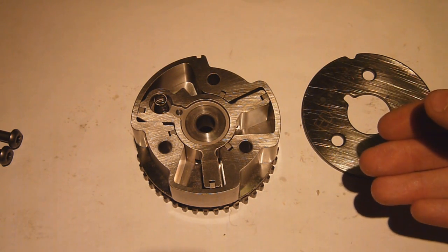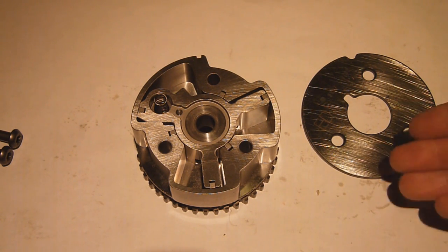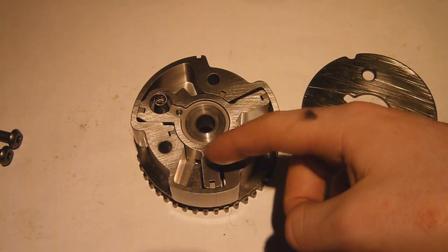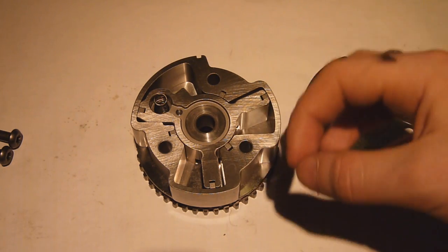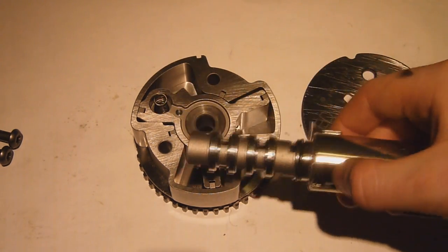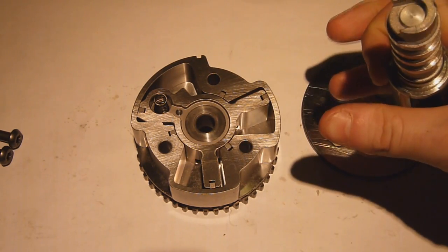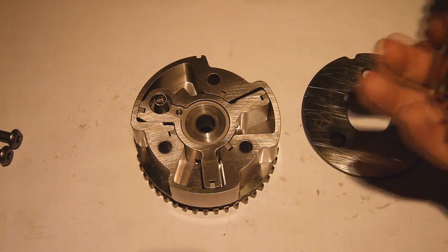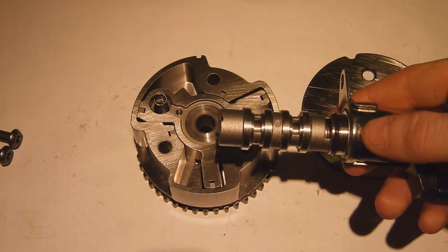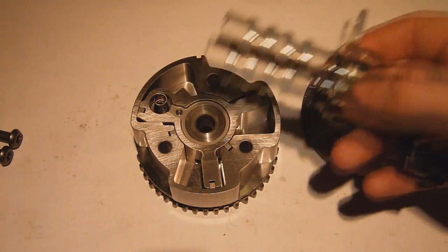The thing I like about systems like this is that it does a job, it does it well, but it's simple - there's no complexity behind it. And you can also get a system where instead of having a hydraulic actuator, you have an electric actuator. So instead of having a valve there, you've literally just got an electric motor which basically twists it depending on where the ECU wants it, which takes out all the oil feeds you need going into the centre of this stator.